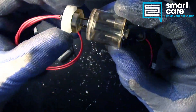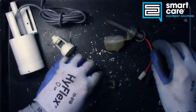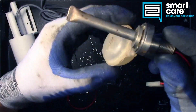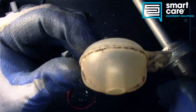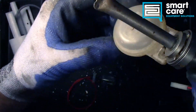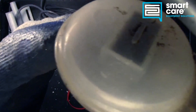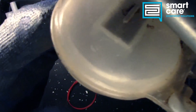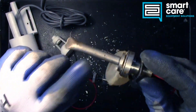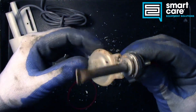In this example you can see pretty clearly where the magnets are. But in this example it's all sealed up, so we'll have to cut it apart. You can just sort of see the magnet sitting right here, and as it swings up against the sensor you can actually hear it actuate. This one is interesting in that it also has a thermocouple inside it for sensing temperature, so we'll take a look at that as well.